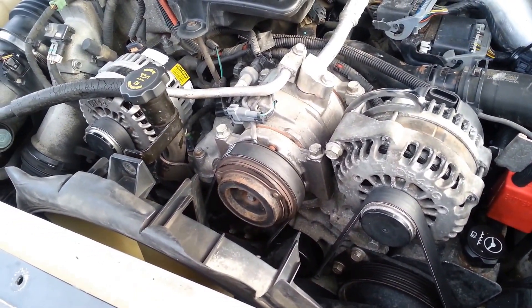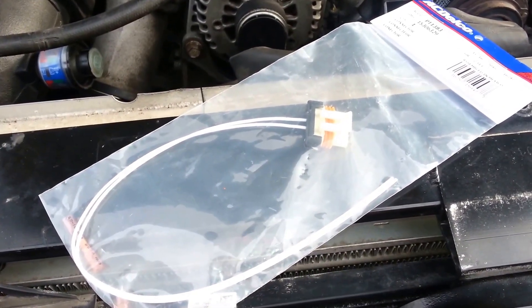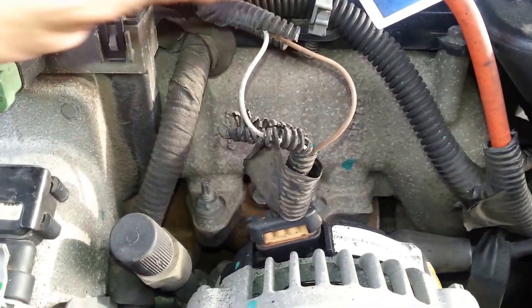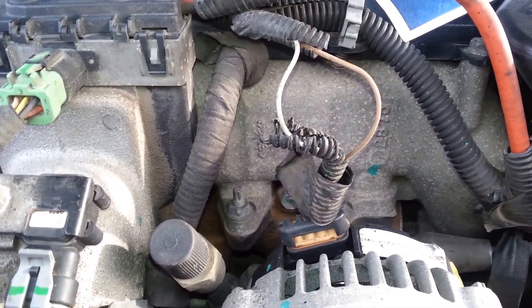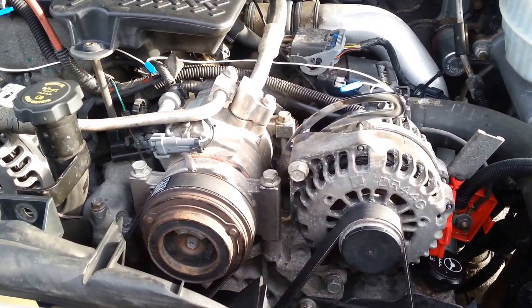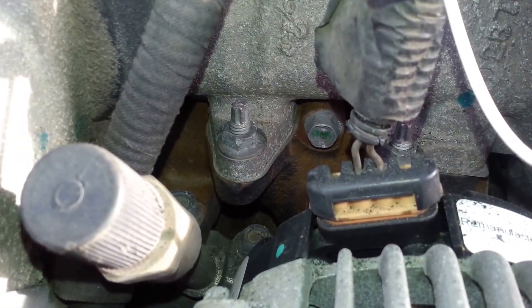I'll get the wiring done here and I'll show you how that looks. I've got the replacement accessory part for the whip that comes from the alternator. I'll be tying only one of the wires into the brown wire from the existing alternator connection, so when this alternator turns on, that alternator will turn on at the same time. I've got the splice in place — the brown wire is on the right-hand side of the connector.